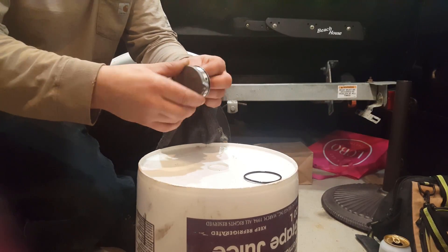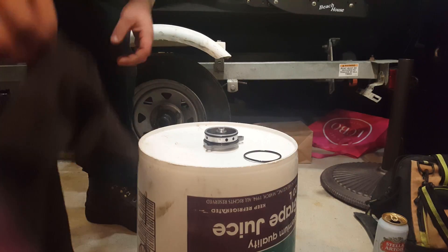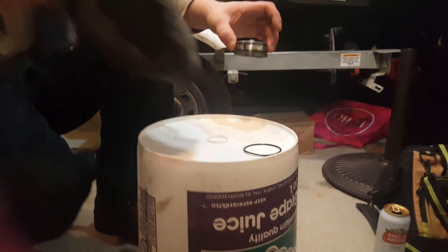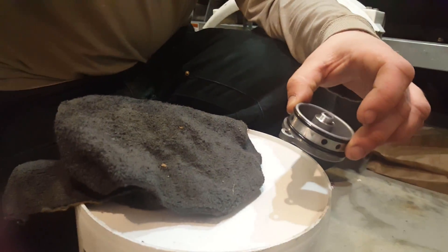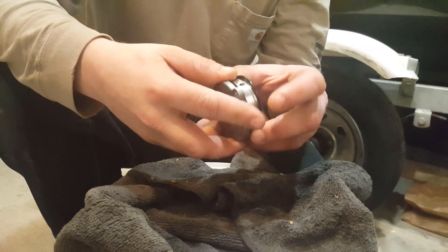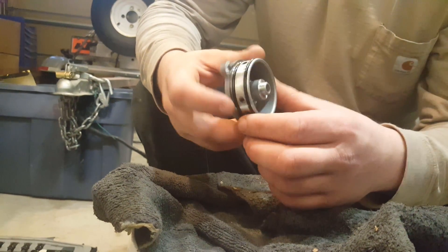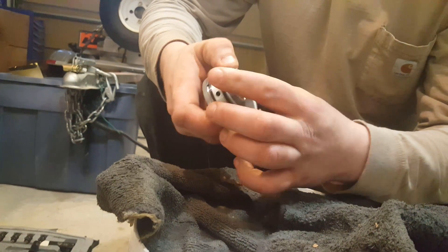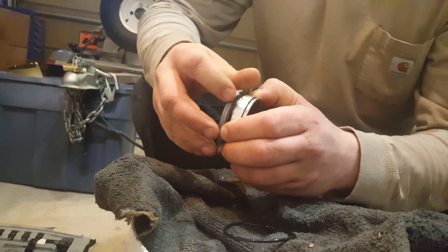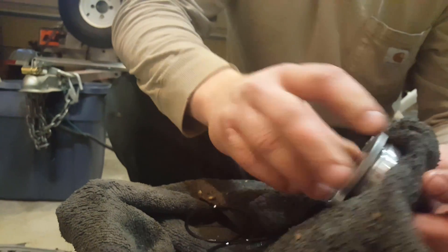Once you've got it off the bike, clean it up — make sure there's no oil sitting around and all the passageways are clean. Get some brake cleaner and give it a good spray. Before that, make sure you take off the o-rings since we're replacing those. The Wix oil filter came with a new set. To remove the o-ring: squeeze here, push up, and you can get your finger under it — it comes out easily with no damage.